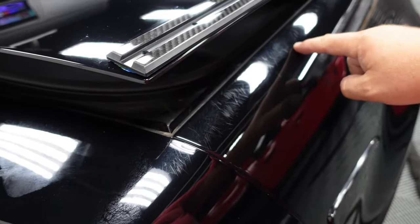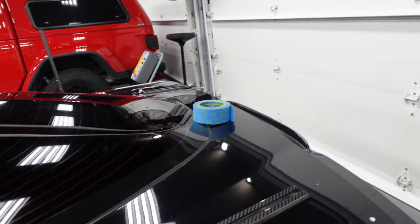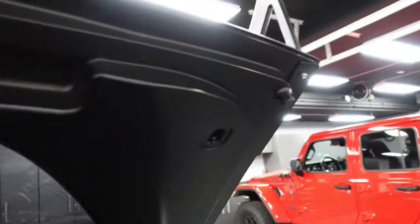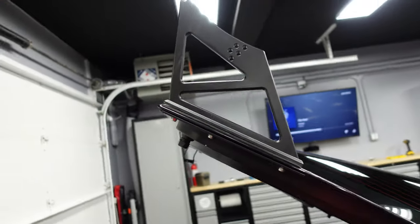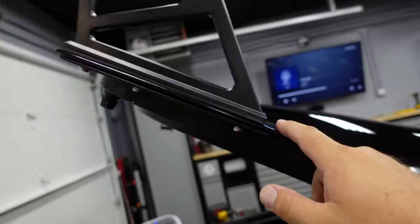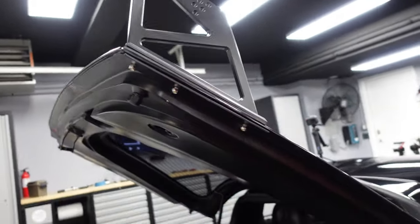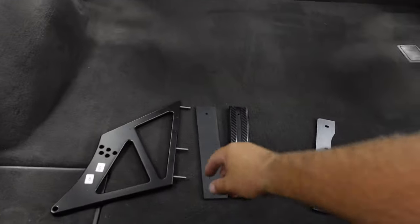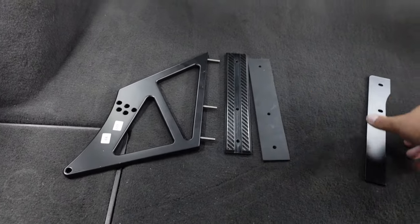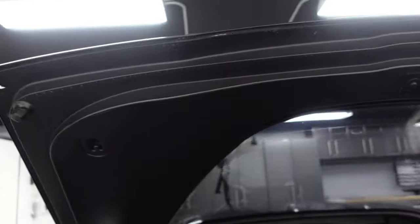Damn, look at all those scratches — this baby needs a polish. The holes are drilled: three here, three there. Let me fill you in on the next step. You can see the holes on the inside. Over here I've loosely fitted one of the brackets. You've got the bracket, the carbon fiber top piece, a rubber gasket, and then a backing plate. They don't want you to tighten anything until everything's together. So you have the top piece, thread that in, then the rubber gasket, then the mounting bracket, then another rubber gasket, and then the backing plate. I'm gonna tighten this down a little, install the other one, and check in with you.